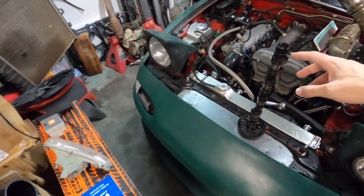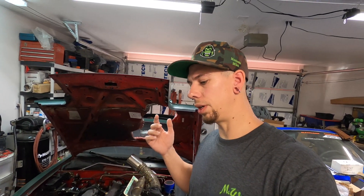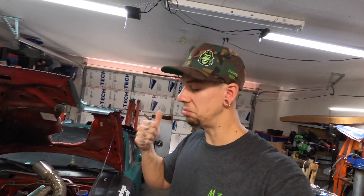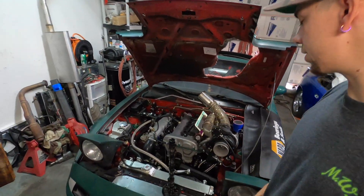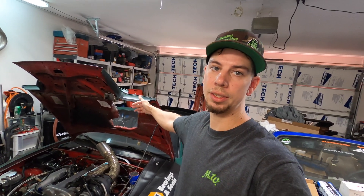The reason the cam hasn't been installed yet is because I have to mess with the timing — I'd need to take the timing belt off — and I want to know if the water pump is bad first. I don't want to do the timing multiple times. I may buy an electric pump and bypass the mechanical one if needed. All I have to do is take the cap off, get it up to temperature, and make sure the water is cycling. That should be it for today's video. The SpeedyEFI new board is a 1.3 board — I had the original version one which only had a 2.5 map sensor; this one has four bar. Thanks for being here, see you in the next one.